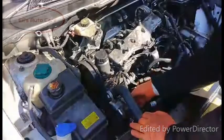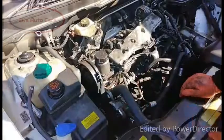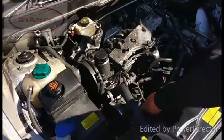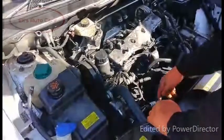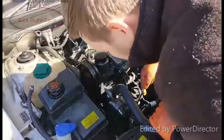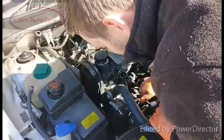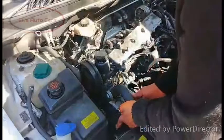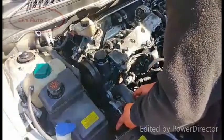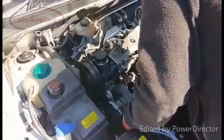So here's the power steering pump. You'll have to disconnect the alternator belt, but it's already off on this vehicle. As you can see down in there, where my finger is, it's a 17mm nut — or a bolt — holding the hose on. So we're just going to crack that off. Spin it out all the way. It's only a soft nut, so you ideally want to just be patient with this, not put too much force on it, because you'll round it off.